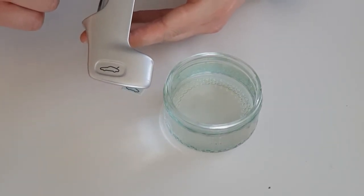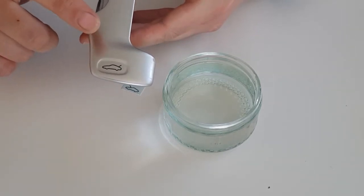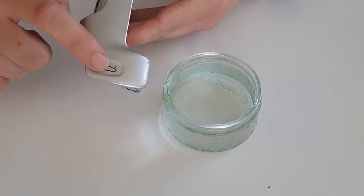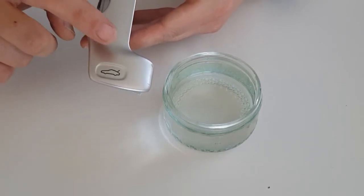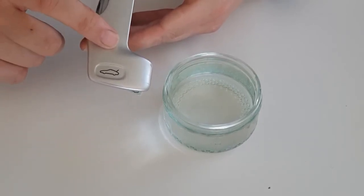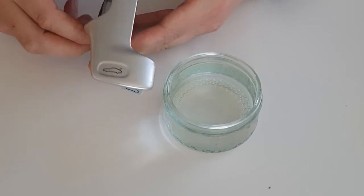Usually to do this, it would all be stripped off and then painted in the silver. And then once painted, the new transfer will be put on and then lacquer applied over the top of it. I'm applying it onto this one before it's stripped, just to demonstrate how it's done and to show you how the new transfer compares to the original one, which you can see there.